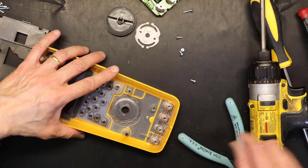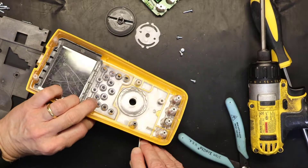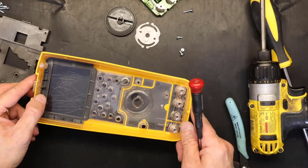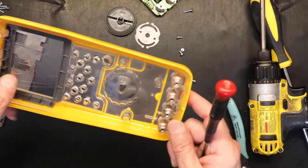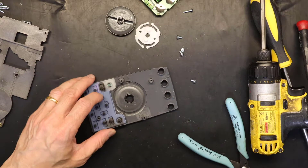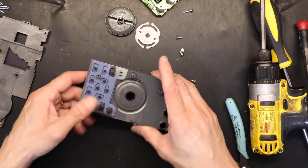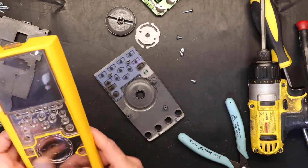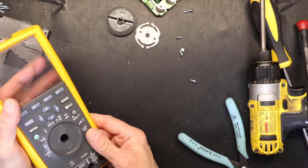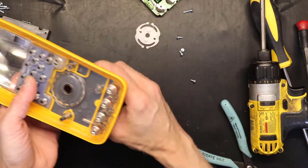All of these should be oriented correctly so the motherboard isn't in the wrong setting. Now let's open the front face — be careful because the buttons can fall. Open it like this because these could fall. Buttons are individually seated underneath — see, they're individual buttons. So that's what needs to go here, it goes right here. Put this in the exact same position.